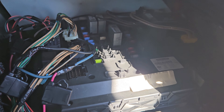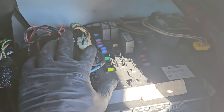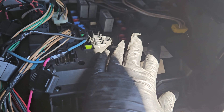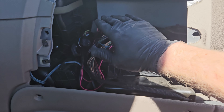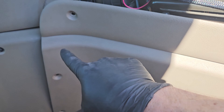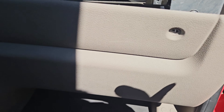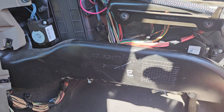And there's your SAM cab — it's held on by two bolts and one nut. I would strongly recommend going ahead and taking pictures of all connectors as they are, so you don't get anything backwards. Let's go ahead and remove this lower cover with the T25 Torx screws here and two hidden ones on the bottom.